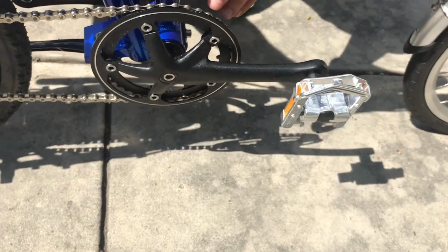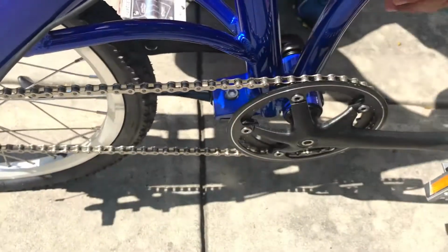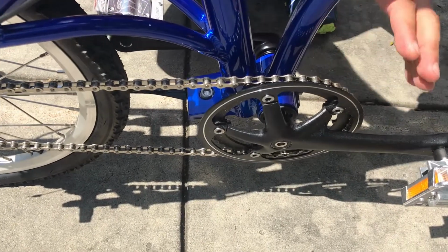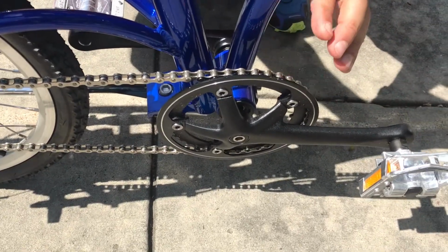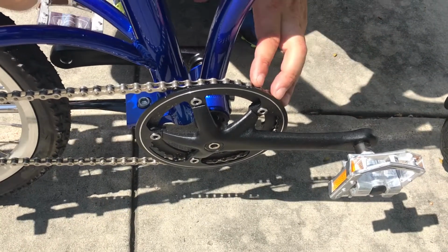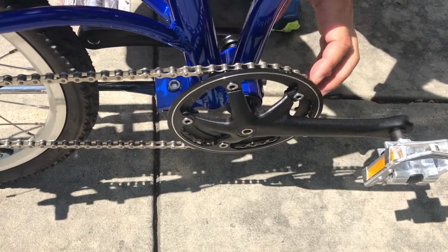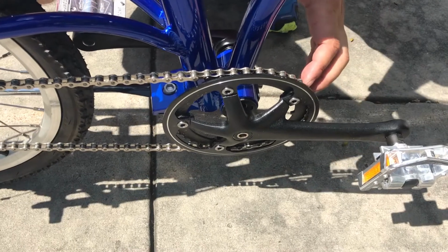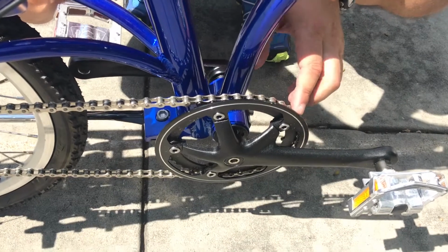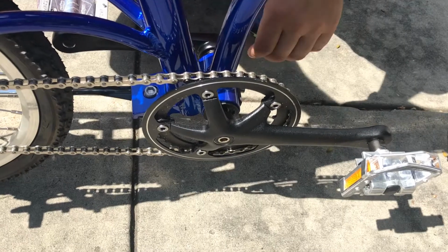Very beautiful. We have a stainless steel chain on this bike, which is really sweet, simply because a lot of the people that buy internal hub bikes use them on boats. And the weakest part of a bicycle system on a boat is the drivetrain. Generally the chains rust. Even zinc coated chains, which are supposedly made to be rust free, rust very quickly. Stainless steel or a belt drive are the ideal solutions for a bike on a boat. So this is actually one of the better solutions out there.